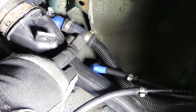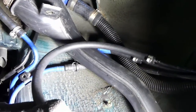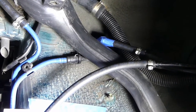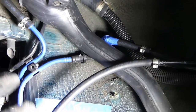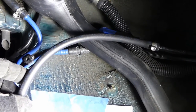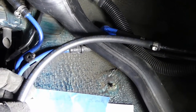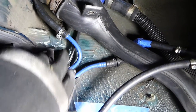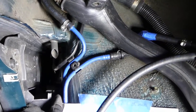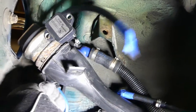With the exception of this hose — you can only buy it in full lengths of about three feet and it's around $45. I found this hose to be excellent quality; I'm actually very surprised it's in as good a shape as it is after 18 years. Nevertheless, I replaced it with new BMW original hose, which you buy in one-meter lengths. It's not cheap but it lasts. Anyway, this 8x13 millimeter hose transitions to a blue plastic hose that goes to the charcoal canister.